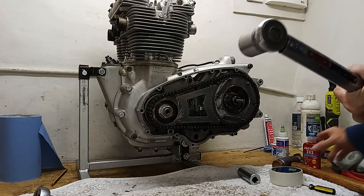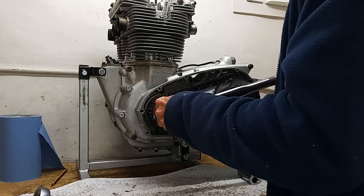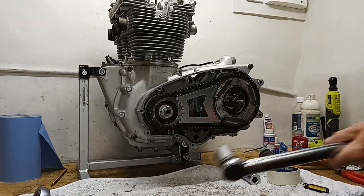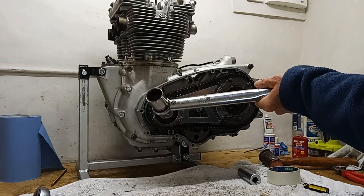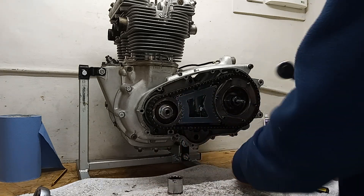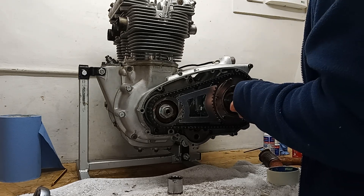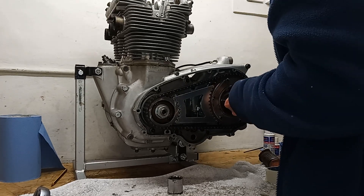Elderly neighbour sorted - let's have a go tightening these up. This one's going up to 60 foot-pounds. And look at that - you see it locks that primary chain absolutely solid. There's no bounce or anything like when you use a rag or a piece of wood - it's absolutely rock solid. And there we go, we're up to 60 just like that. Now I'm turning the torque wrench up to 80 - it's between 75 and 80 but I tend to go to just about 80. I change the socket and get the long deep socket on. Blimey, that is tight. Done.